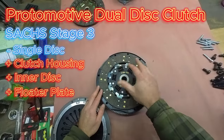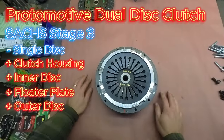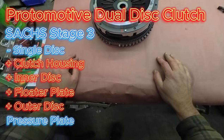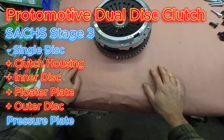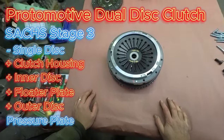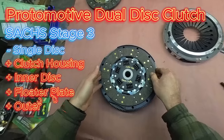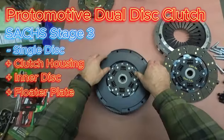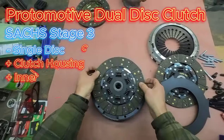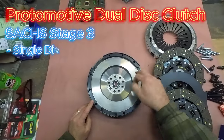Then go ahead and put the outer disc in place. And once again, please stick the pressure plate on. And voila, we have a dual disc. So using all the Sachs Stage 3 components, it's very simple to go from a single to dual. So let's show that in reverse order. Pressure plate off, outer disc, floater plate, inner disc, clutch housing, ring gear, flywheel,